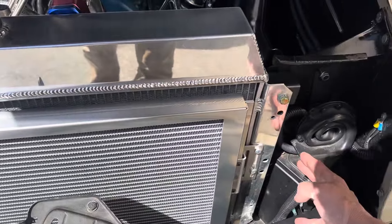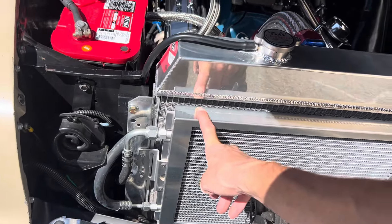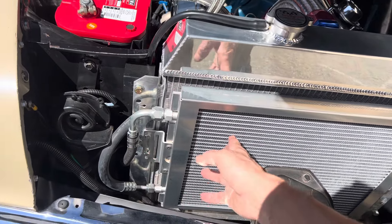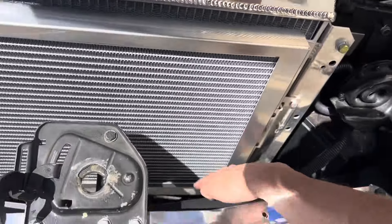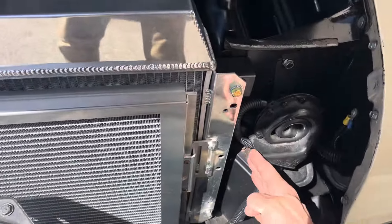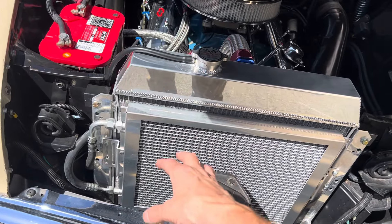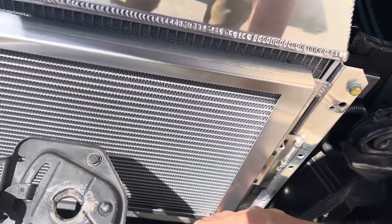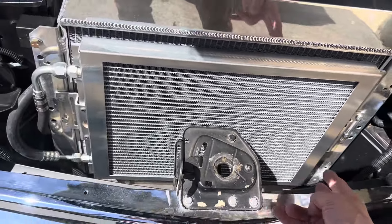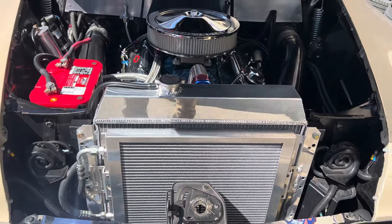On this one I would try to find a condenser off of something like a Sienna van, or something with dual air conditioning — a dual AC rated condenser that you can find, modify, and put inside here. They're about almost the same height, made a little bit longer, and you can make your own custom brackets. You could get a modern high-efficiency condenser like from a Sienna or other dual evaporator vehicle that already has the receiver dryer in it, and they have a sub-cooling channel for sub-cooling the liquid at the bottom — four to six rows — and that would be the ideal arrangement to put onto this system.